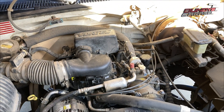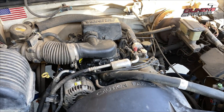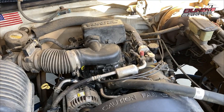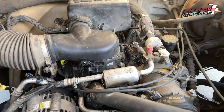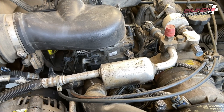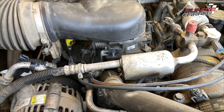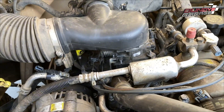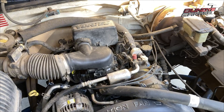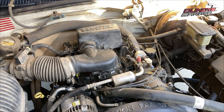What I'm going to do is try to drive this thing around, put a load on it, and see if I can blow that out. If not, I'll go ahead and replace the whole spider injection system — the upper intake manifold will have to come out. I don't really want to do that, but this truck has a hundred thousand miles on it if not close to that.